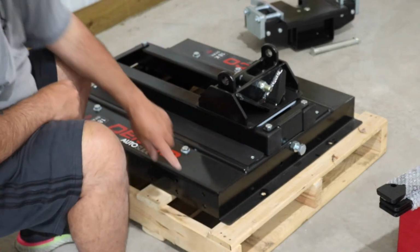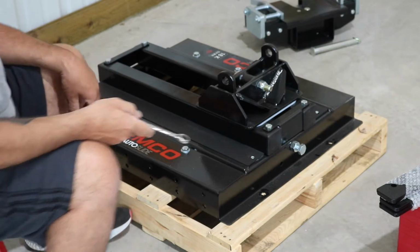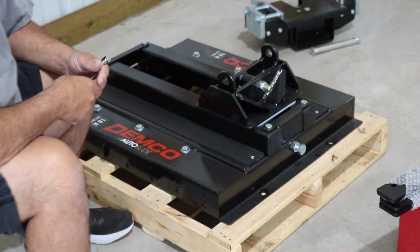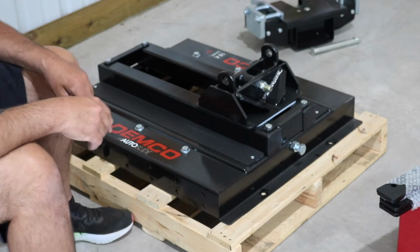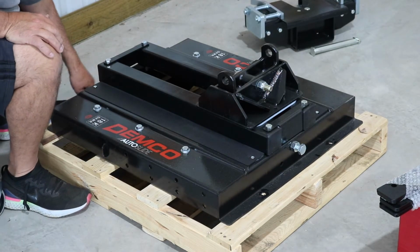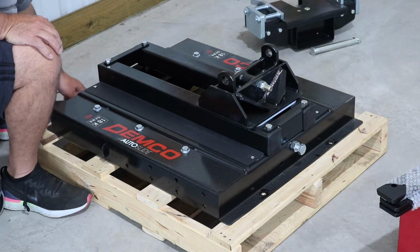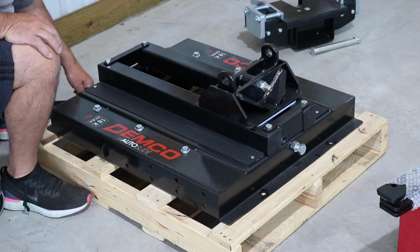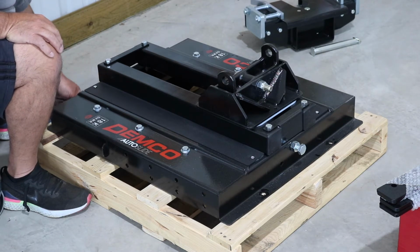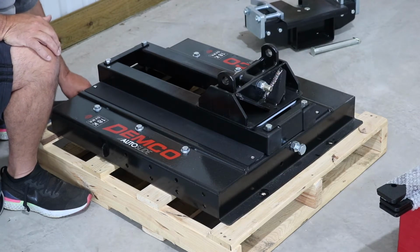So while the camera was off, I measured from edge to edge. It is 27 inches. So 27 inches, and the 2 small brackets are 1/4 inch apiece. That makes it 27.5. So I have to use the smaller brackets instead of the larger ones. And it sure beats putting the larger ones on and finding out, oh, you need a different large and small, or both small. So I think that was the right way to do it.